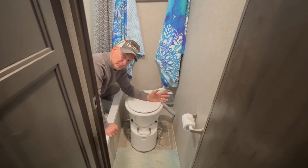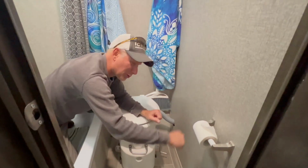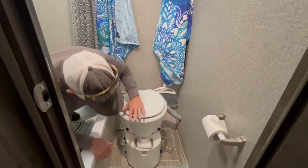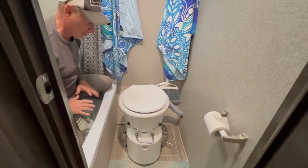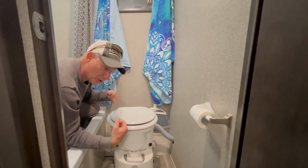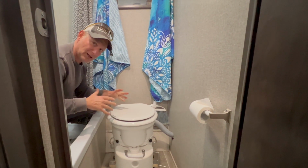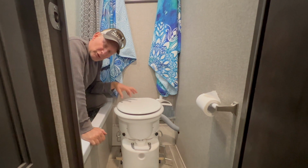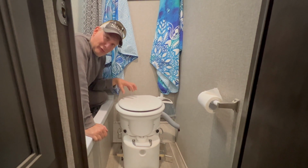Okay. So when it is time to empty the solids, they say when you crank this, as you can see, this goes pretty easily. They say when it gets pretty hard, it's about time to dump. There's these four little wing nuts that separate the top from the bottom bucket solid. And then you twist this off, set this off to the side, and then this just attaches from the floor, and you take it outside, and you put a bag over it, you flip it over, crank the handle, all that comes out, flip it back, it's all in a bag, and then put your new brick of coconut husk powder in here with some water to help break it up, and then hopefully you're good for 4 to 6 weeks.